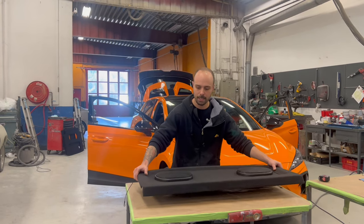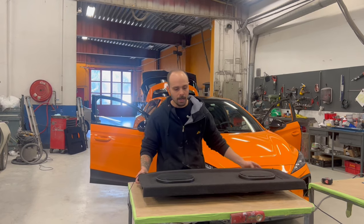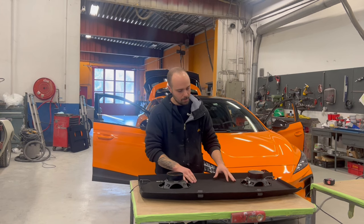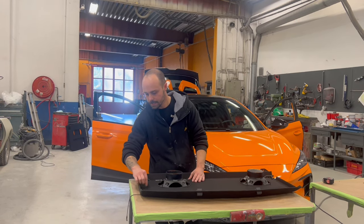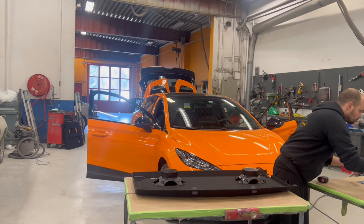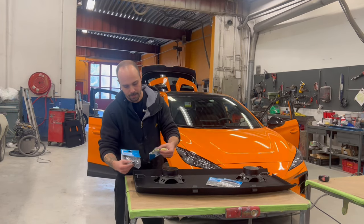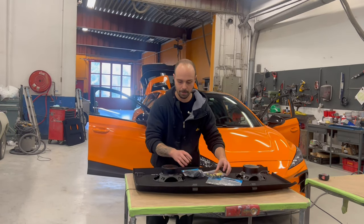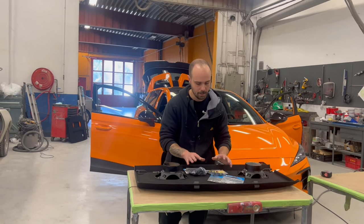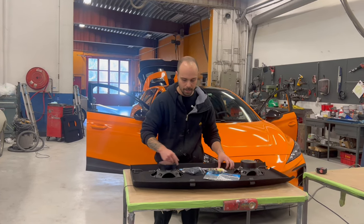car and you put back inside the car, what I'm going to do is that on the cables that go to the amplifier, I'm going to use a connector. So we are going to run our cables under here on the right side. And we are going to use a connector and pins. We are going to use all this so we can connect and disconnect the back speakers if we want to remove this and put something big in our baggage. So now I will make a time lapse of how I will make the wiring here.